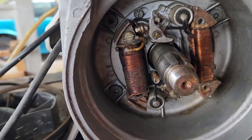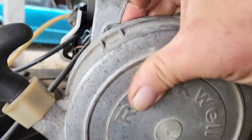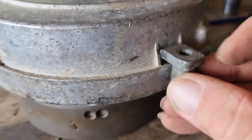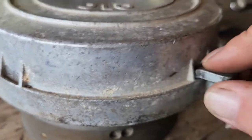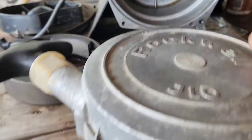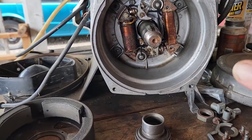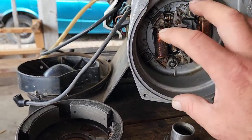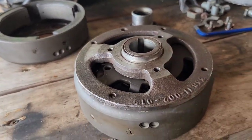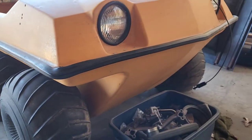That's where I'm at. To adjust it, you got this screw here so this whole plate will rotate to where it'll open and close on the cam as it spins around. Top dead center, the keyway is pretty much upwards right now. I also got these nice little clips for the cover, so when I put this back on you can see those spots right there — that's how those clips are going to hold that in place. These were like eight bucks on eBay. I got new bolts for it too — all the threading is the same. I'm going to rig up a timing light: a little nine-volt battery with a little car light bulb, so when the light's on or off it'll tell me if the timing is incorrect. Match it up with the number one spark plug position and get this thing dialed in. Awesome sauce — part six is on the way. We're going to get this engine worked and put back in the buggy. Stick with it, thanks.